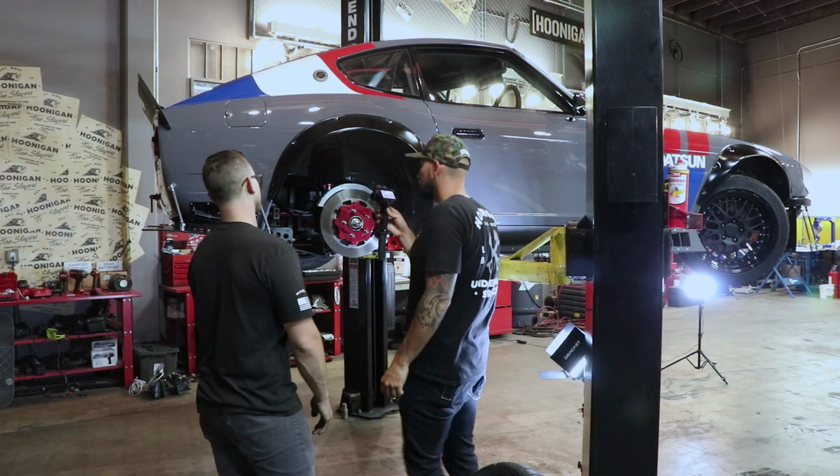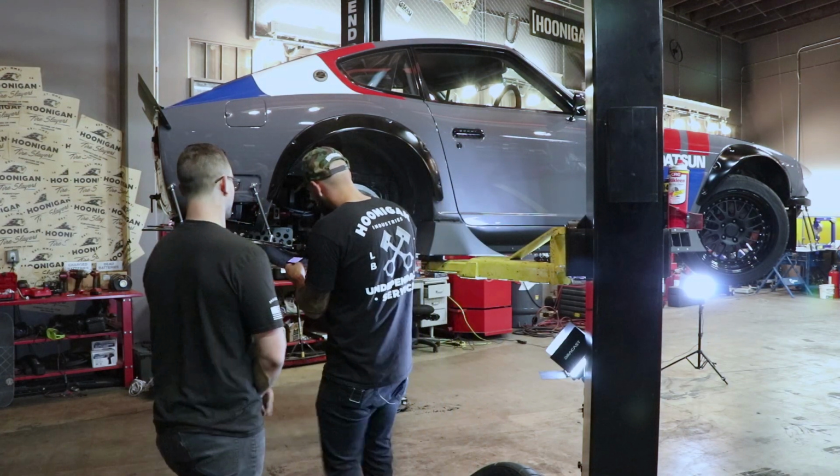Everywhere. But you can really start seeing where these brake ducts come in. So from the side skirt down in here, it wraps through, and then picks up on what looks like a custom made one. To do yourself any good with brake ducting, you need to get to the inside of the rotor. Yeah, I had one little, 1 square inch basically where you could get there, and so I made it hit the whole back side of the rotor and go to the one part I could with these huge, big old billet spindles there.